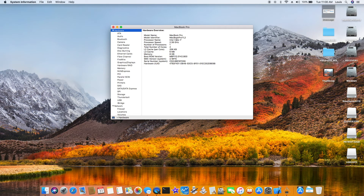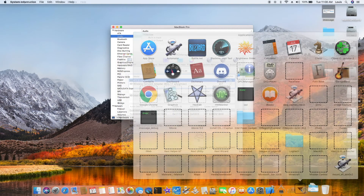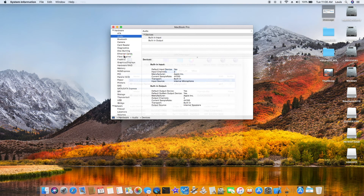So what I use is MacBook Pro 11,2. The audio is IDT — specifically IDT 92HD91BXX, 76E0. I use AppleALC.kext to patch this one. HDMI and everything is working.